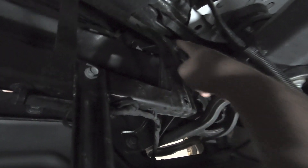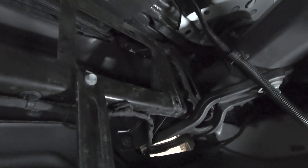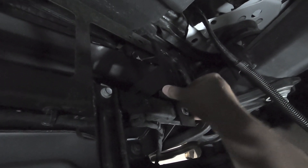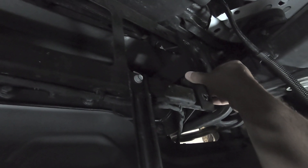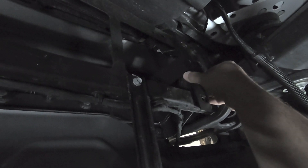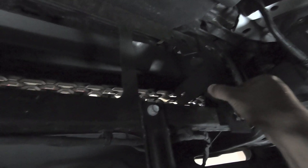Basically there's an open hole here, open hole there. Our bracket with the supplied hardware is just going to line up right with those two holes and that's where it's going to sit. That's going to push our 30-inch light bar right through the middle and give us the light output we need through that grill. It's got some movement — you can move the light bar up and down and side to side to really angle it exactly where you need it.